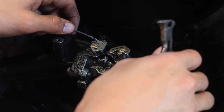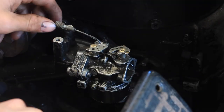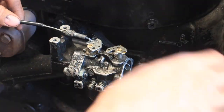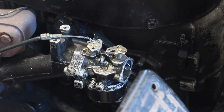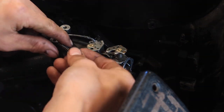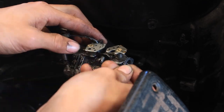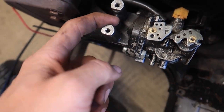So this is how I've set it up — it's a very dodgy way but it works and it's solid. The wire is just wrapped around that hole, then up through another hole, kind of wrapped around like that. Then I'll get onto making the bracket that'll go there for full throttle. I've got a little spring too that can go from there to there. Now I'm making this little plate that goes over the top with a lip down the back, and the cable comes through the lip. I've got to cut the accelerator cable down so it fits and doesn't have heaps of excess.